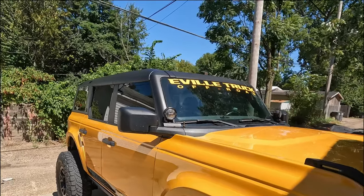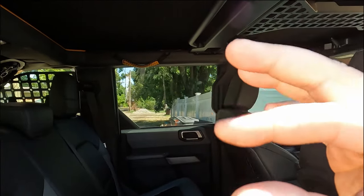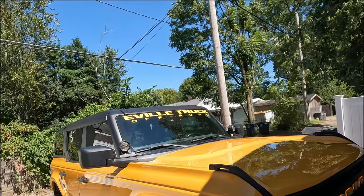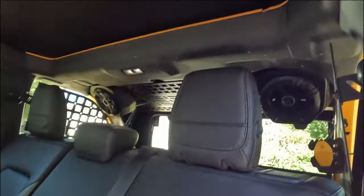The other question I had was about the construction — how are these constructed? I reached out to Turn Off-Road and asked them. They said it is honeycomb, similar to the OEM hardtop. The OEM has honeycomb cardboard with fiberglass on top and bottom, but the core was dry — not fully soaked through. This top is a bit thinner, but the resin is soaked all the way through, making it one solid piece. It's not two separate layers that can delaminate. That's where the extra weight comes from — it's more densely packed and makes for a more solid top.